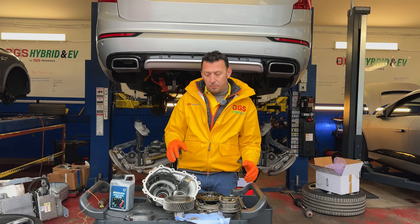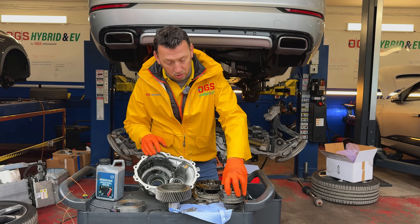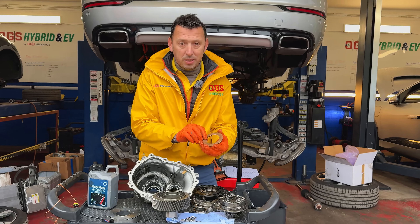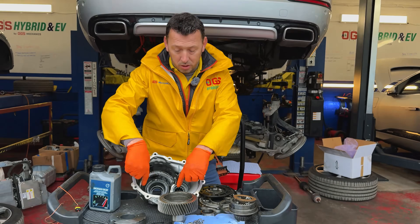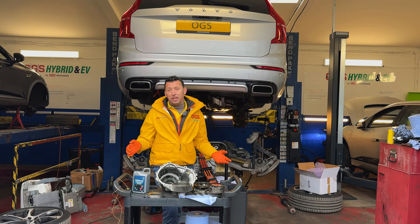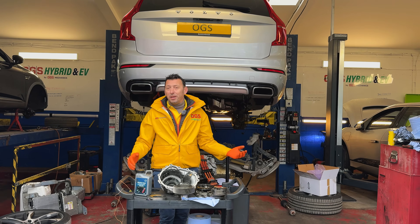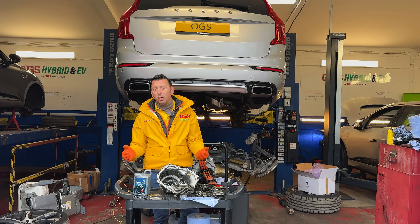And then this way the motion goes from the electric motor to the wheel. Obviously at high revs there are some components that wear out over time, causing all this with the low quantity of oil. And oil degrades anyway. There are many other transmissions that will say oil is lifetime — but how can it be? Because anything that's in motion is going to cause wear. It's a simple law. The oil will degrade due to temperature and so on.